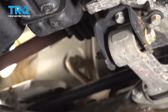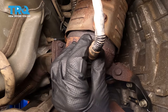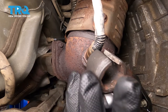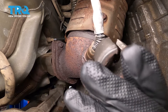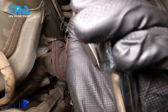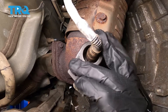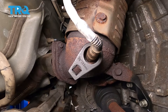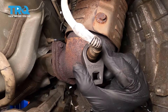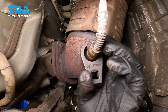Underneath the vehicle we can find our catalytic converter. We're going to be replacing this downstream O2 sensor. We're going to get on it with a 22 millimeter O2 sensor socket and a breaker bar. It's going to be a little awkward to get your O2 sensor to turn with your breaker bar — just use your hand as best you can with the breaker bar when you need to. Just be aware that this wire will turn as you're turning the O2 sensor and that might bind up.